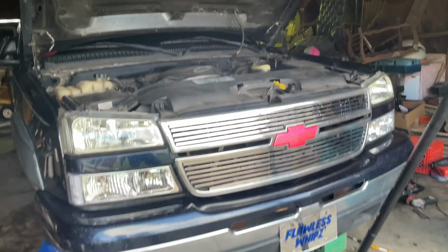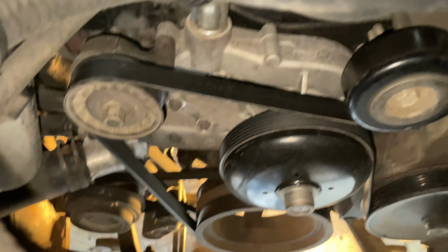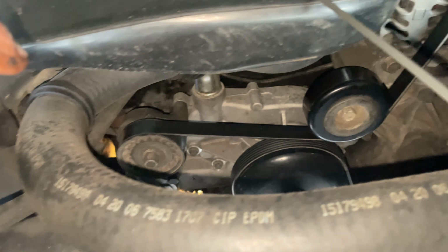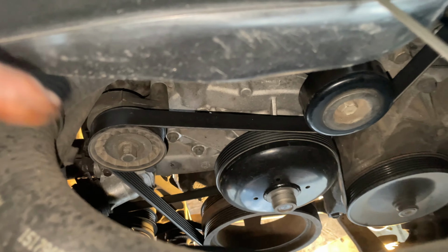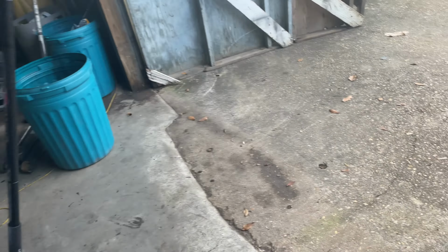and putting that stuff in it, then my next attempt at a solution is I gotta take the water pump off. I take everything off, radiator hoses and everything, and I'm gonna change the oil pump. I'll put a high pressure oil pump. All high pressure oil pumps are like $150 to $200, I think. Not really wanting to do that, but to do that I gotta take the whole front of the motor off, like the water pump and whatnot, like I said.